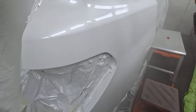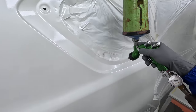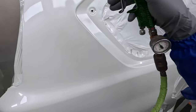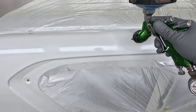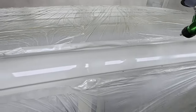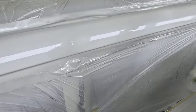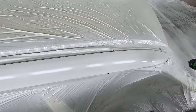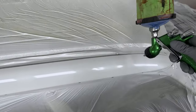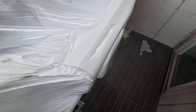The finish also comes down to having enough thinner in your base coat. I put 30% — it was actually one of you guys, Gordon Proctor, who left a comment suggesting to try going 30% reducer in your pearls, the base coat with the pearls. I did that on this job and I think it helps. It helps it dry out and helps you minimize the orange peel in your clear coat as well.